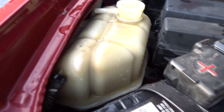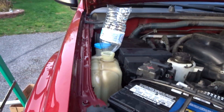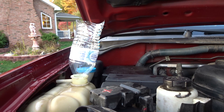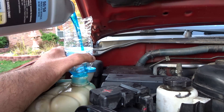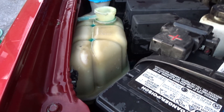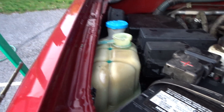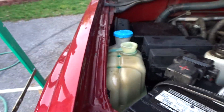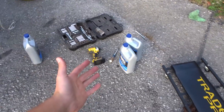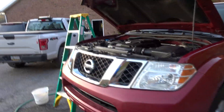If I move it around, there's no antifreeze in there. So you're going to fill that up next. You're going to want to fill up the antifreeze reservoir to this line right here — that's just a safe level at first, and then if you need more, you can fill it up more. We filled it up to the top. If it's too much, we're going to use a syringe or a turkey baster to take some antifreeze out of the reservoir. The guy at Napa told us we'd need three jugs. In reality, I'd say you need two, but it's always good to have an extra one.